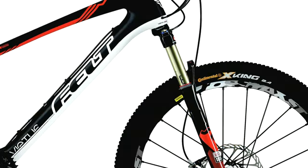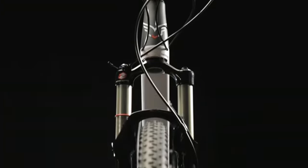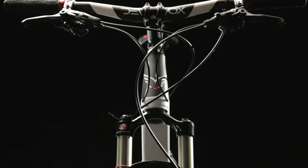All of the bikes will be shipping with 120mm of travel at the front, which gives them a more performance feel. However, there is nothing to stop a rider putting a 130mm fork on the front, adding in 130mm of travel at the back by moving the travel chip, and this gives you a more aggressive trail bike feel. It doesn't affect the geometry when you adjust the rear travel. This means that a rider can still run a 120mm fork at the front, yet gain an extra 10mm of rear suspension travel for more aggressive trails.